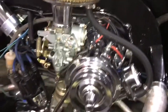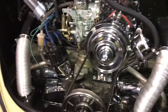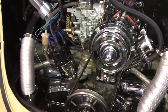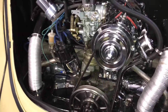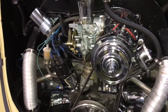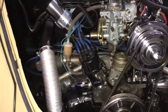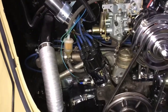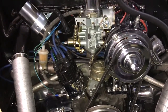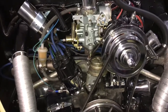That's my personal opinion, and remember this is just an informational video — I'm giving you tips so you can see all the things you'd have to deal with and fiddle around to get that intake out. Earlier models like the 1200, 1300, and 1500 had the single port, and I can't recall exactly how complicated that removal is, but you're much better off working your engine on the floor, or on an engine stand if you have one.